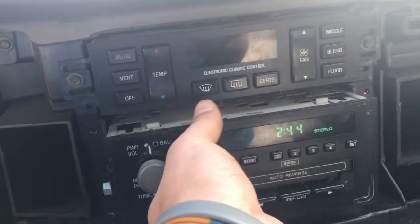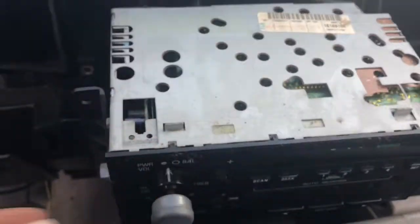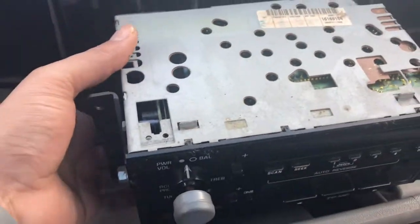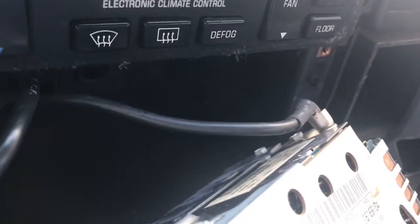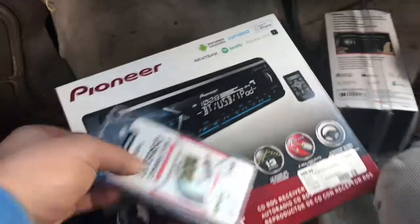Okay, as you can see I took the screws out — got the screws right here. Now I can go ahead and pull this whole thing out and start unplugging everything. I'm gonna go ahead and turn this radio off. Sometimes I unhook the battery under the hood, but I ain't gonna do that to this one. I'm finna unplug the radio cord — this cord right here is the radio cord to the antenna. This is the receiver cord right here that you want for your CD player, so I'm gonna unplug all this and we gonna get to it.